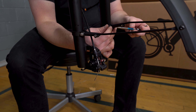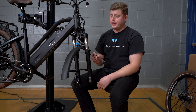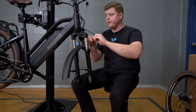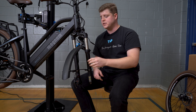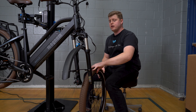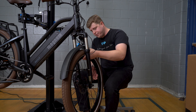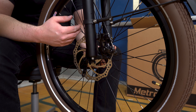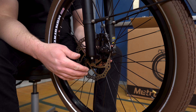We're going to set them about there and finish tightening them up. Then we'll go ahead and connect our headlight to the main harness — again there is an orientation there, it's very clear to see, just make sure that's all the way installed. Last but not least, we're going to grab our front wheel and install it into the fork dropouts. Mind that disc rotor and line it up with your dropouts. Once we have our wheel successfully installed in the fork dropouts and our disc brake rotor successfully installed into the caliper, we're going to go ahead and tighten our cam on our quick release.